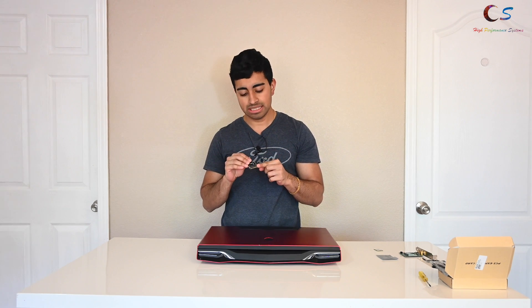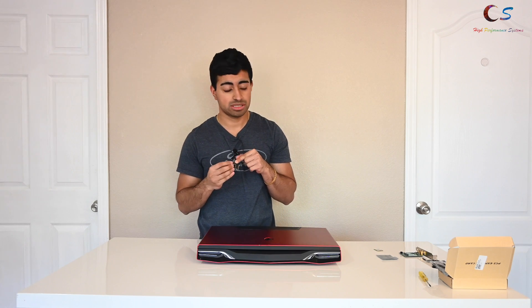For a laptop, what you're going to need is this adapter. This is a mini PCIe to an NGFF M.2 adapter. You're also going to need an antenna because the antennas in the older laptops with mini PCIe are actually thicker. I'm going to put a link in the description to everything I bought so you guys can also buy it. And then of course you're going to need your 802.11ax or Wi-Fi 6 card plus Bluetooth 5.0 card.